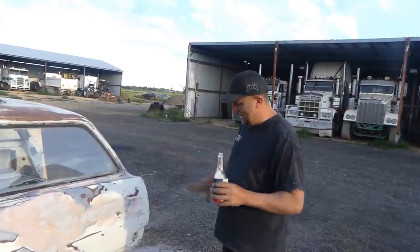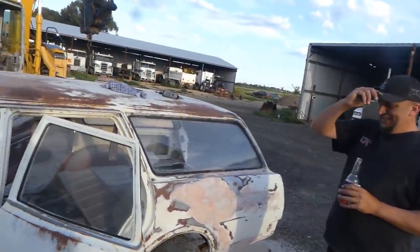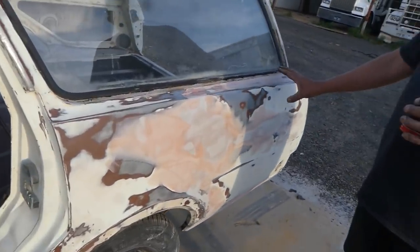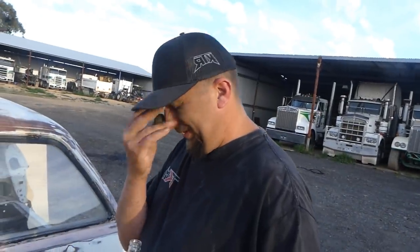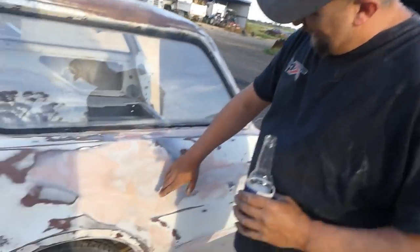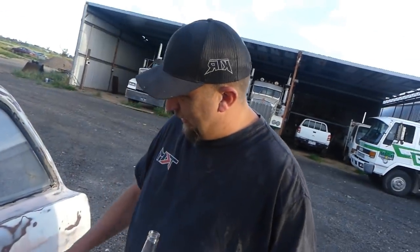I've been at school editing the video and packing out the t-shirts. So the run down: remember this quarter panel - someone had put this quarter panel on, popped the top, joined it here and down there, but rather than use a welder they'd fiberglassed it. So it had all cracks down here where they joined it. I cut down with the grinder, found where it was joined, and put some spot welds in to make it last.